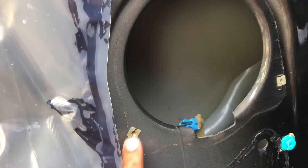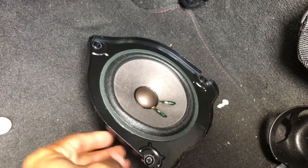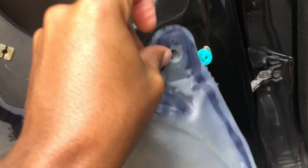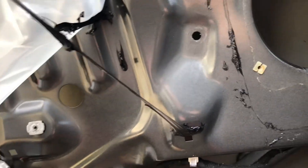You'll also need to remove the actual speaker itself so you can maneuver more in there. There'll be three screws — one, two, three. That's the speaker right there, that's the Phillips head. Then there's this plastic piece right here — it comes off like this, it's pretty self-explanatory when you peel it off. It's pretty sticky but you can just move it out of the way.